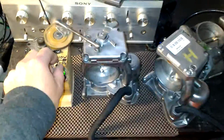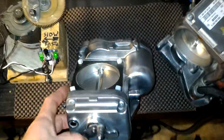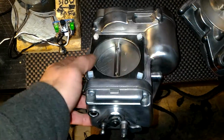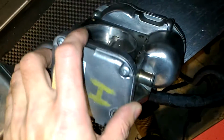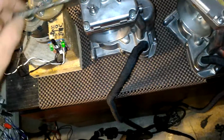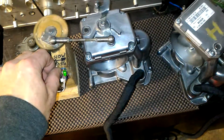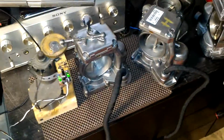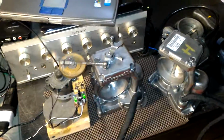Oh, one more thing, Lars. Because I was cleaning the driver's side unit, the gasket came off because it was not silicone, so I just put some zip ties here to keep the gasket on the throttle body case, but you will cut the zip ties when you install it. This throttle body here had the gasket glued, and I did not unglue it. I just left it where it is. Because you will get them back, and if you have no gasket, you're going to need to buy another gasket. These gaskets seem to be alright. Obviously, I recommend replacing them, but they can be reused if you would like to. They usually never leak, but do not over tighten the bolts, because you can strip the heads, and then that's going to be a big problem.